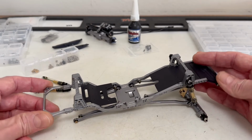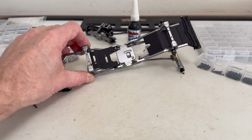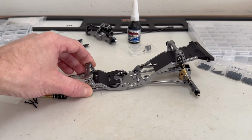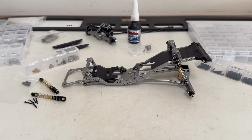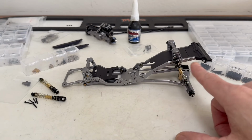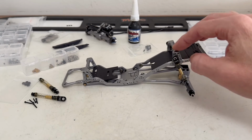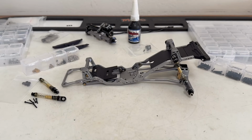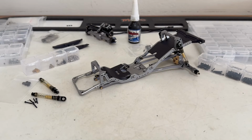So I'm gonna get the front axle hung, probably just the same, and of course get the sliders back on there. I had to get those off to be able to get those upper links on there and access the hardware head on the outside. But the only other note is definitely use some thread locker on these nuts. And actually I'm gonna come back a little further in the build and probably thread lock most all of these that go into metal on the frame. The ones that go into plastic, you don't need to, but like the shock towers, definitely the shocks, links, a lot of that stuff is metal into metal. So it's better to be on the safe side, but I don't like to do that early while I'm still taking things on and off and setting it up, because it'd just be a pain in the butt. But anyways, a little more and I think we'll have a slider.